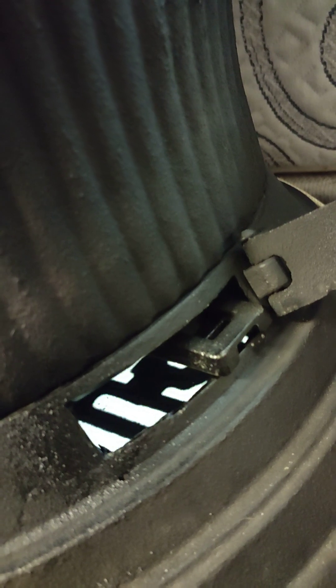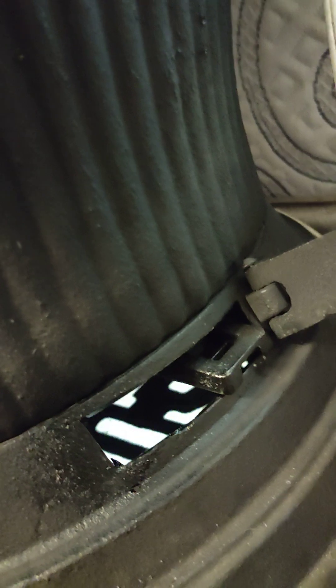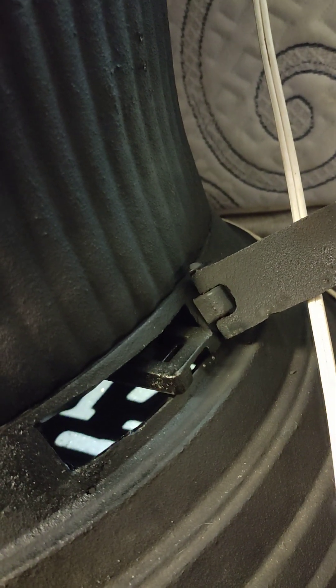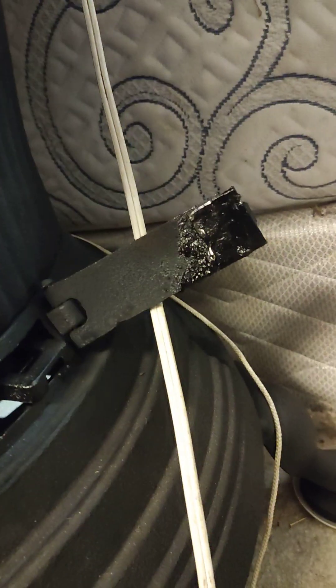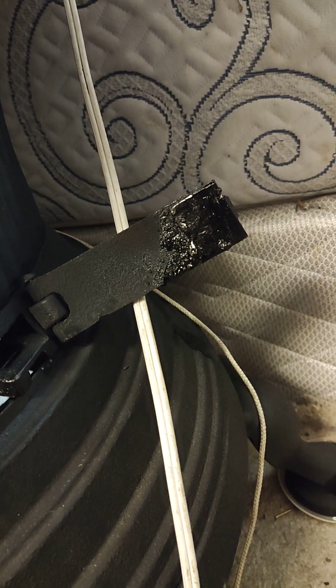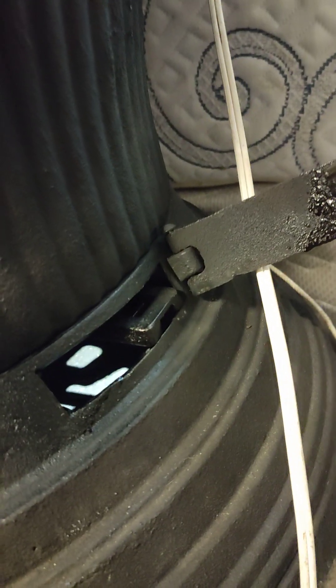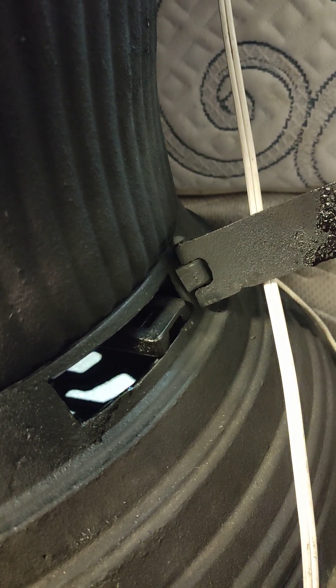It seems to be working. It was a pain trying to tear into that, but if you've got a dremel tool you can pretty much do it easily. I went a little bit further than I should have, so I had to take a piece of metal and weld it to the end just so it can cover the end. Now it works good. That's a fix for the shaker grate issue — the American Stove Company doesn't really know how to make stoves, unfortunately.